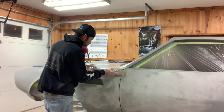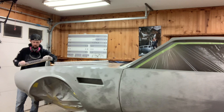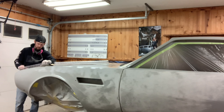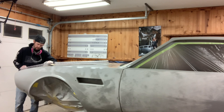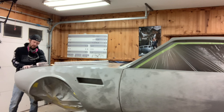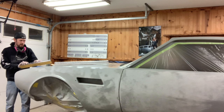If I'm blocking something like the front of this car with just a piece of plexiglass or a block that has no option for hand placement — just two grips — you start bending that block and putting all the pressure right in the middle, not distributing it out to the ends, because you're flexing the block against the car. The tube lets you space your hands out better. The vertebrate design distributes the pressure evenly to the base of the block.